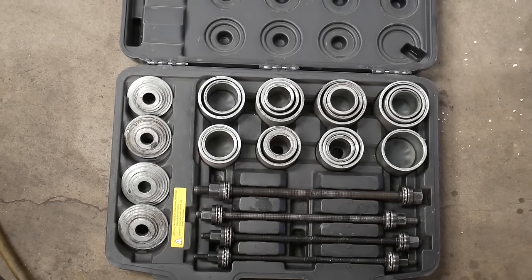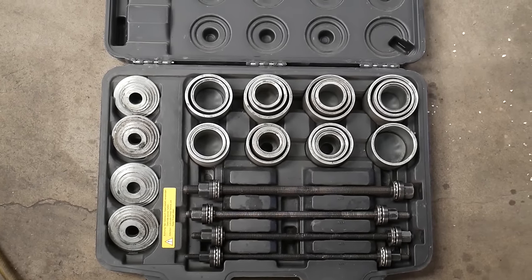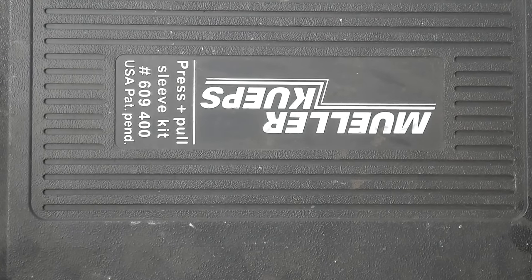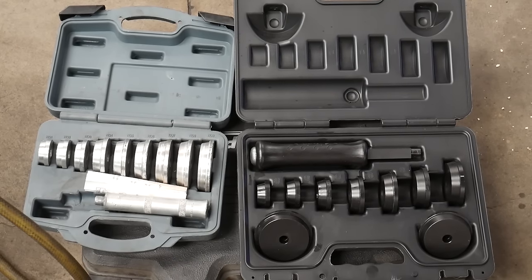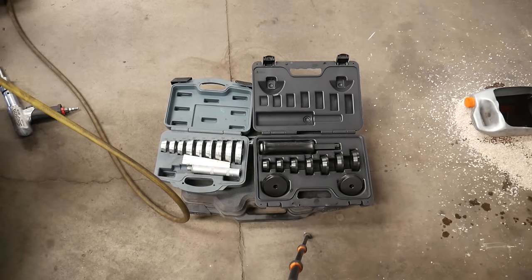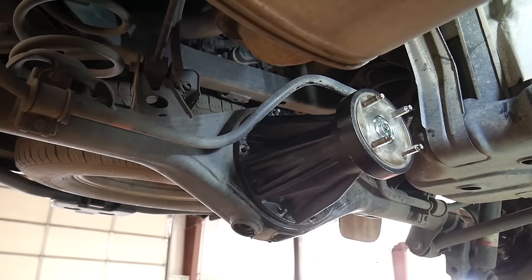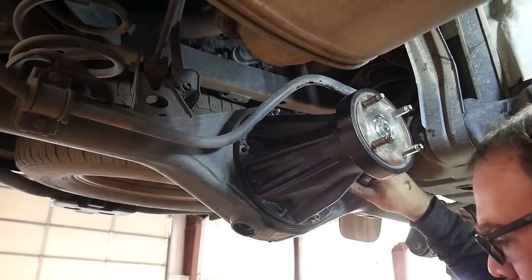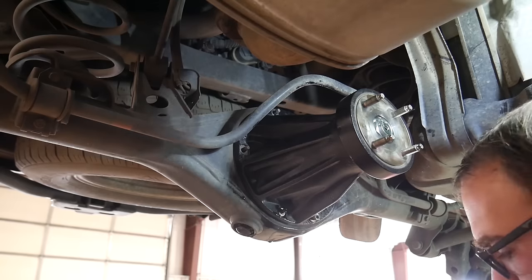Now that everything's tightened down I'm just going to apply a little bit of oil to the side bearings. In case you're wondering, this is the kit I use to grab those sleeves — it's a Mueller and Kueps kit for pressing out control arm bushings, but the interlockable sleeves are nice for tapping stuff on like these bearings. Here is the Snap-on and Blue Point bearing drivers that I have — the aluminum driver is a generic one you can get anywhere, the black one is a steel driving set from Snap-on. I hope you found this video helpful — this is just how I rebuild them. If it did help you, hit that thumbs up button, and if you want to see more videos like this go ahead and subscribe and click on the bell. Thanks for watching and I'll see you guys next time.